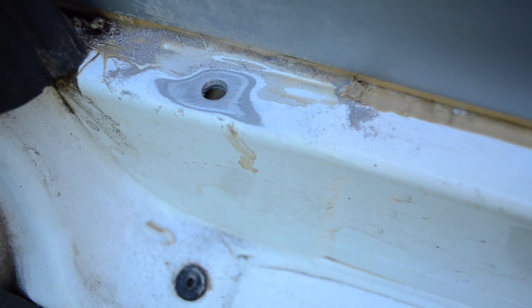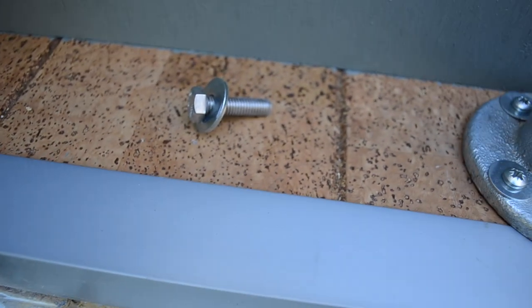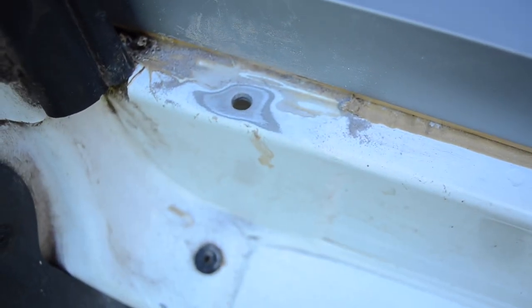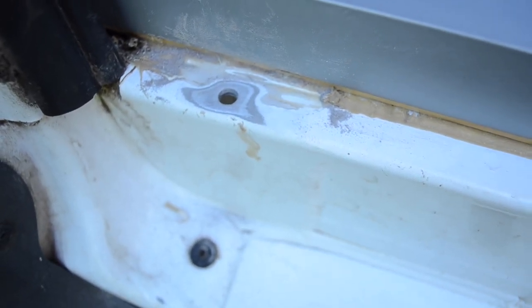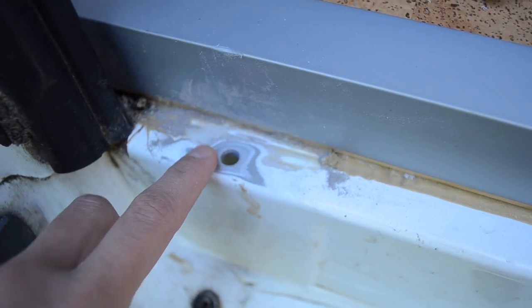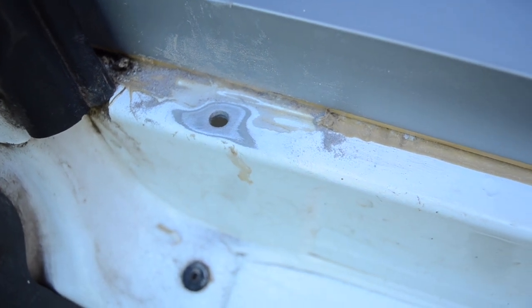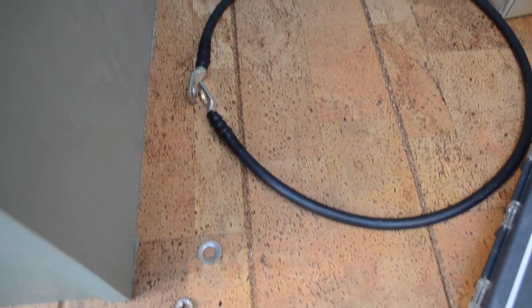But Jordi has removed some paint at the back of the van because we have to connect the electric circuit to the van to ground it. So you can see the spot where Jordi removed the paint in which a bolt can go through. And there we can connect the electric circuit to the van, and that will help for extra safety. And I'll explain it later when the entire thing is installed. And he'll be using this cable to do that.